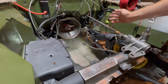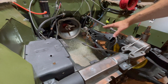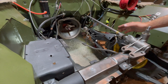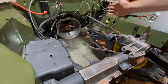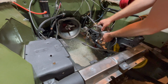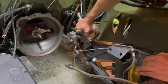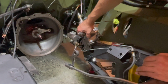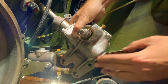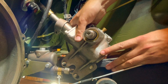With your Ross steering box now angled straight on to the hole that is through the firewall of your Jeep. When there's no engine, this is how you do it, but if you have an engine, it's a different story. So we would just push our worm gear and steering box straight through the firewall, and then we'll go up at an angle. We'll get close to those 3 bolts, and now we will thread those bolts through the steering box. So now we will get those 3 bolts lined up, and we'll just push them through the steering box right to the frame, and that is all 3 of them.